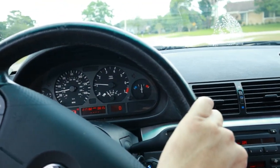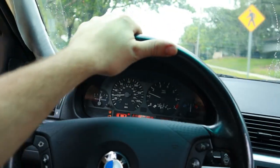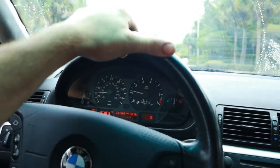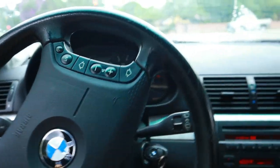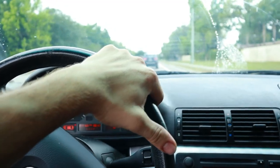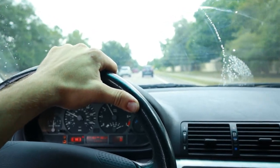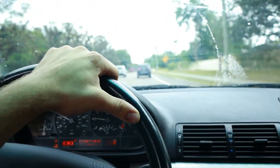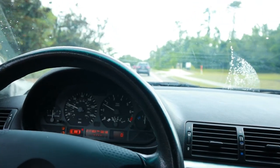I'm definitely getting a lot of vibration from the exhaust, because it's obviously dumping right under the floorboards right there, so I can feel that. But I also think that we're getting a bit of noise back there from, I think, the drive shaft. So I'm going to be hunting for one really quickly here. Definitely need to replace it so that we don't have that crazy vibration. Otherwise, it's just going to make our center support bearing fail again. So we need to get that taken care of. Exhaust or not, or it could be the drive shaft, but definitely want to get it taken care of.